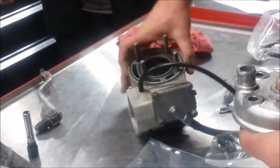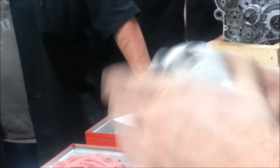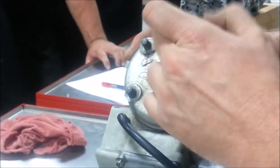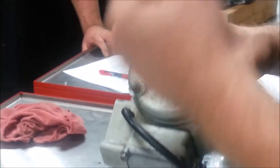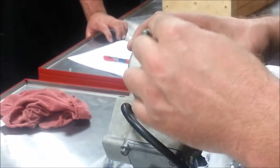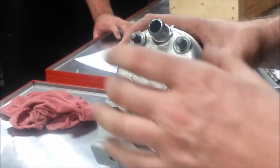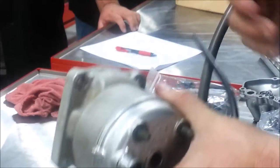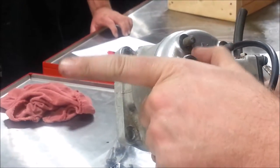On this little 85 here, one of the things students noticed is that the cylinder head will only go on one way. Suzuki has foolproofed this so you can't accidentally put it on the wrong way. But if all the holes were in an equal pattern and you torqued this down with the hose inlet facing back, you'd have to redo your work. When you take these off, you want to be very intentional about knowing what direction something goes.